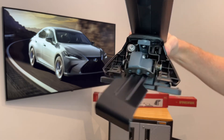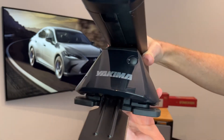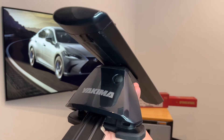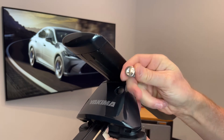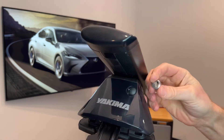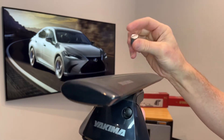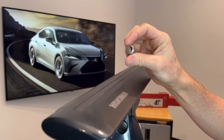We can go ahead and put the cover back into place — it just connects at the bottom and snaps at the top. You'll notice here we have a plastic plug, and that plug can be removed and replaced with a Yakima SKS lock core. SKS stands for same key system, and that will enable you to purchase these lock cores in matched sets so that all four of your towers along with other SKS compatible carriers and accessories can all be key matched for convenience and security.